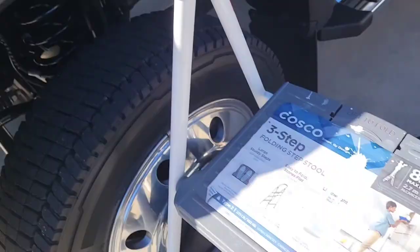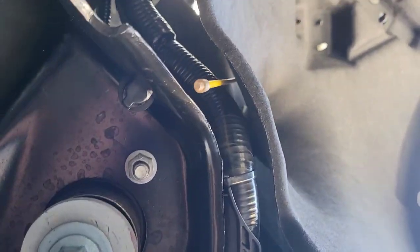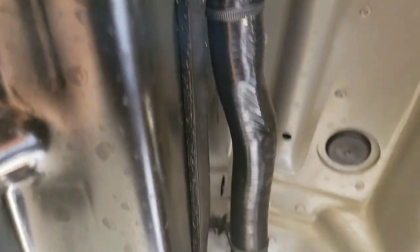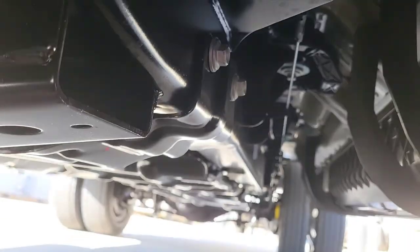Basically I want to go down the factory wiring. So we go down, go underneath, check underneath, fish tape come right up under — no drilling required. So we gonna tape the ends, ring terminals on, we can tape that to this fish tape, pull it into the engine bay. Then we're gonna run along this factory wiring all the way down the body of the truck and we'll end up out the back. Stay tuned.